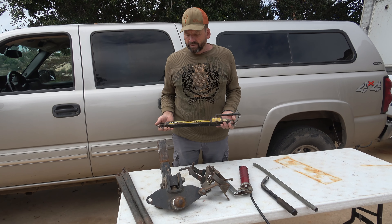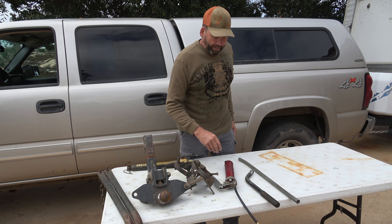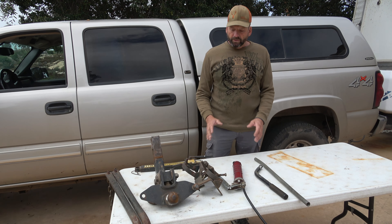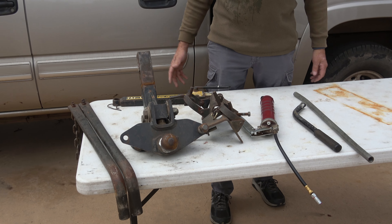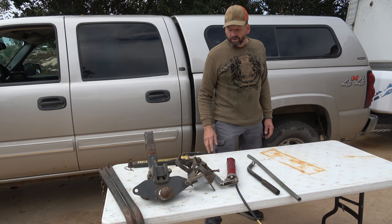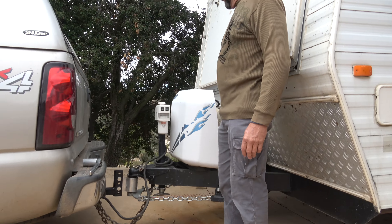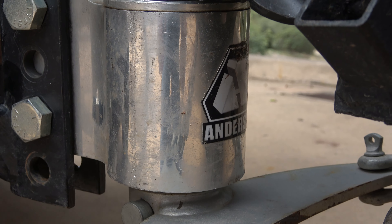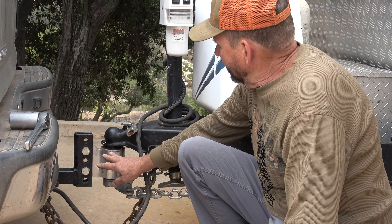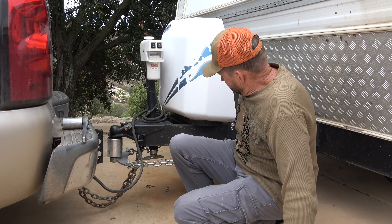If you're using those other systems I'd recommend the sway bar, but you don't need it at all with Anderson. This is the grease all those things require, and these are the leverage arms that help cam them over so you can pull the chains up and put the right amount of tension on. See all this stuff? What's neat is you don't need any of it with the Anderson trailer hitch — the sway control system is built in. No grease needed either. I'm not a sponsor of Anderson at all — I purchased this system. It probably weighs about 15 pounds compared to 43.